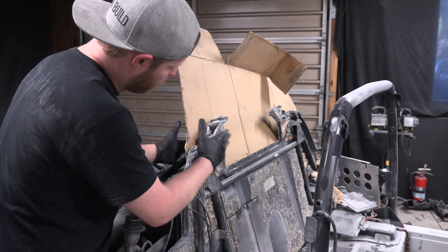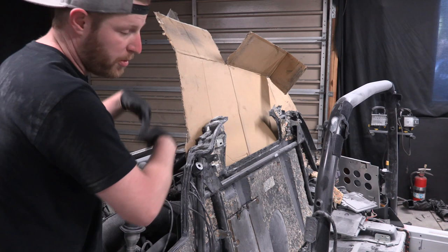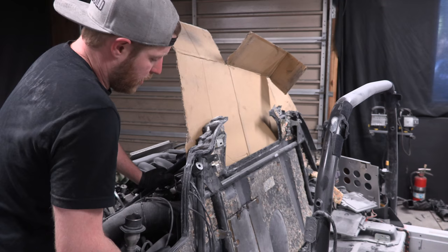We'll place all the pieces right back where they need to be, obviously, when we attach them to the wood. And then we're going to come through and repair everything with the fiberglass on this side. And then after that's done, we'll take our screws out, we'll flip over to the other side, and we'll do more fiberglass. So all I really got to do here is get it to be more than 1/8 of an inch thick and not, you know, impede any of the placement of the other parts. And that's a win. So we're going to go ahead and get started.